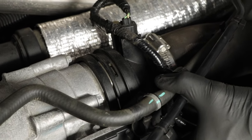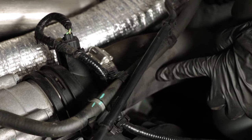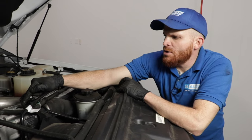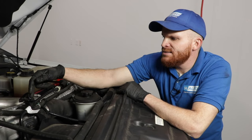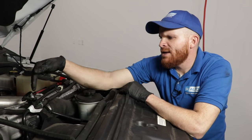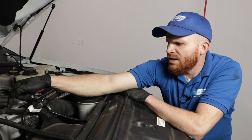The cause is located right here. You have this plastic housing that's located between the intake and the turbo hose. The plastic housing gets dry, brittle, and cracks. Once that happens, the pressure from the turbo getting rushed into the intake blows this off. You hear that loud pop, and now you don't have any pressure from your turbo system, and you're pulling unfiltered air.